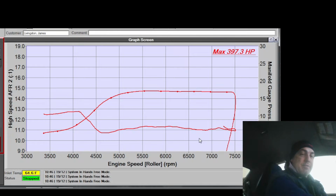Doesn't matter how much air I throw at it. It just does not do it. And it's rich too, because the O2 sensor comes in at 12s. So it isn't like it's not getting enough fuel to do it. It's not like it's running lean on startup. It could be too rich maybe. It's possible it's too rich.